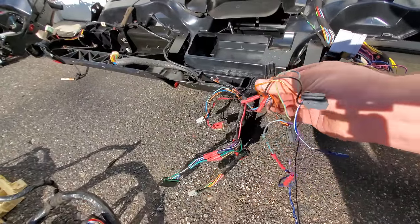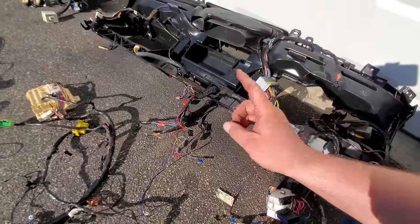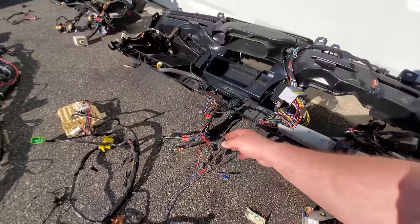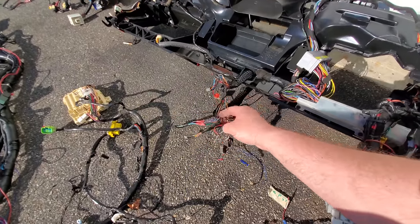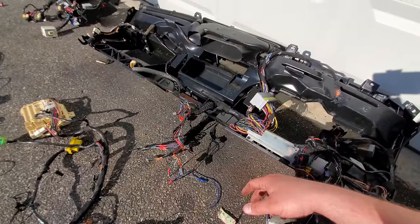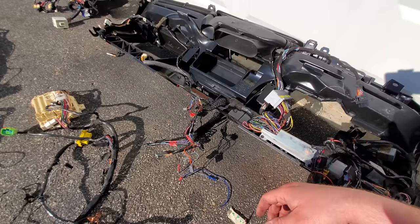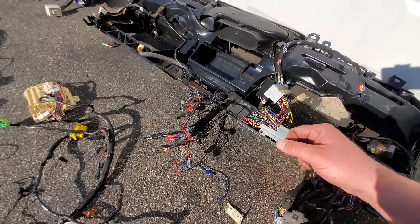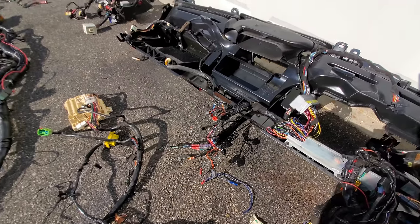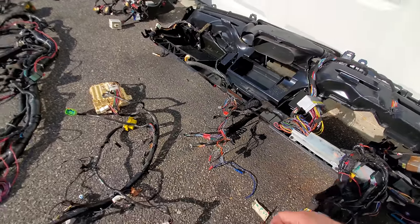Here are fog light buttons and other buttons for other switches. Now an important thing to note: fog lights are one of the few things that aren't plug and play in XJs. You cannot just simply add a button on the three-hole switch bezel and swap out a fog light harness into your header panel — it will not work. The wires don't connect through the harness into the fuse box and back through the header panel. But again, fog lights are very easy to add. Just get yourself a factory three-hole switch bezel, power up the switch, run your wires to a relay, power up the lights and the relay, and you're good to go.